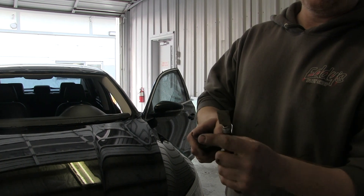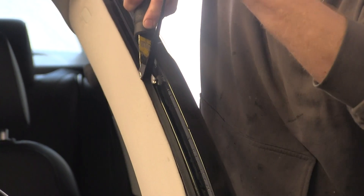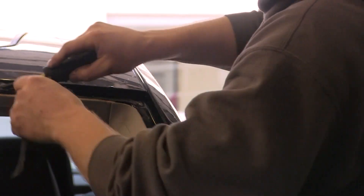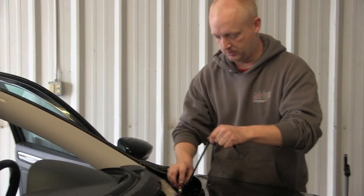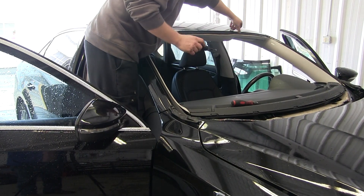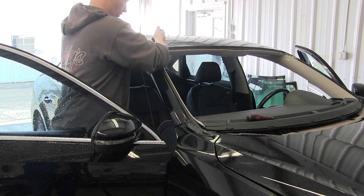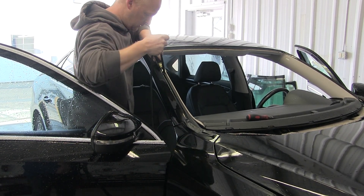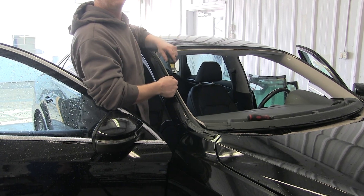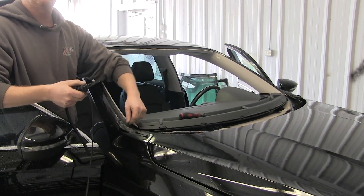He's showing us the tools he uses for trimming — basically types of cold knives. He said you want to leave about 1 to 2 millimeters of the urethane on there. You don't want to take it all off down to the pinch weld — leave 1 to 2 millimeters and then you can put new urethane straight on top of that. He also pulls up on the urethane strip just in case there's any loose paint — he wants that paint to peel up so he knows about it. If some paint does come loose, you want to make sure you do get the corrosion protection, prime it, and do all the things you need to do.